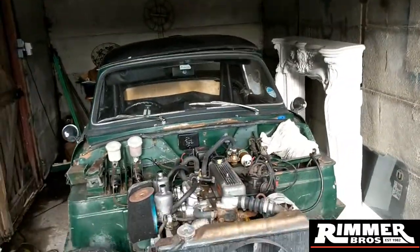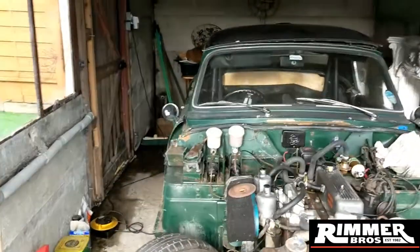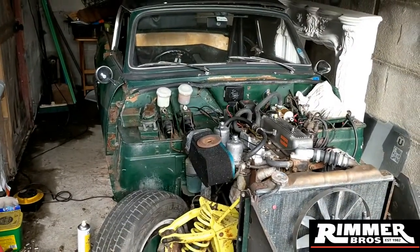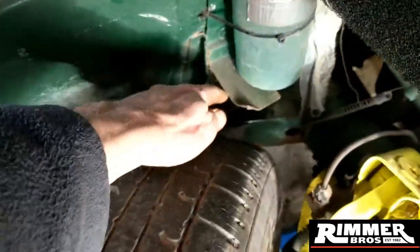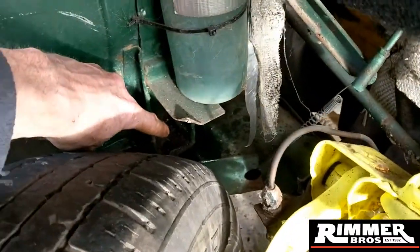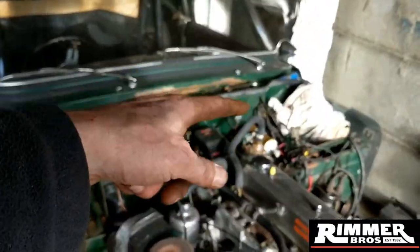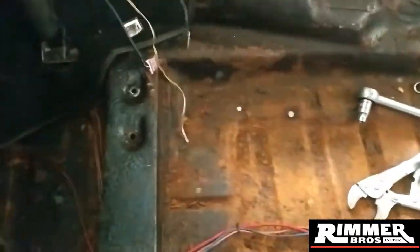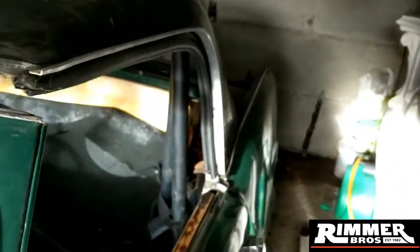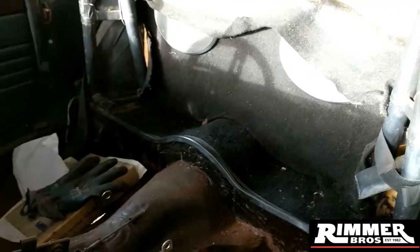Hello guys, welcome back to my channel - just bringing you up to date on what I'm on with at the moment. I have drained the clutch and the brake cylinders. I have removed the front chassis bolt out of there, cut the one off from inside the footwell, done the same on the other side and that bolt came out too - so both bolts came out there, no problem. Both bolts came out of the cross member as well, no problems. I'm just about to take the roof off so I can lift it off and then remove the speakers and the speaker board section, and then I can have a look where the other back four bolts are hiding. Then we're almost ready to remove the tub.